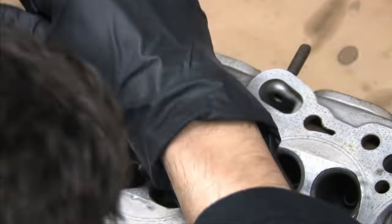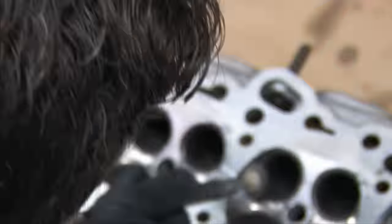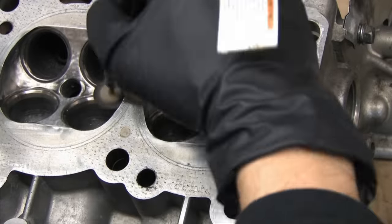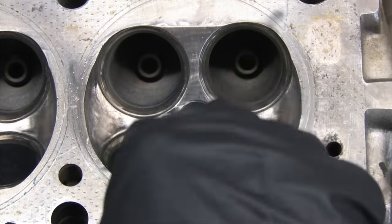On this high compression forced induction engine, this process will be more beneficial than it would be on anything else in my driveway. This car has more than a full point higher of a final compression ratio than my GSX. I also have generic cast pistons that will melt more easily than forged pistons will. Knock should kill my engine dead in a heartbeat, so I want to do everything I can to prevent it.